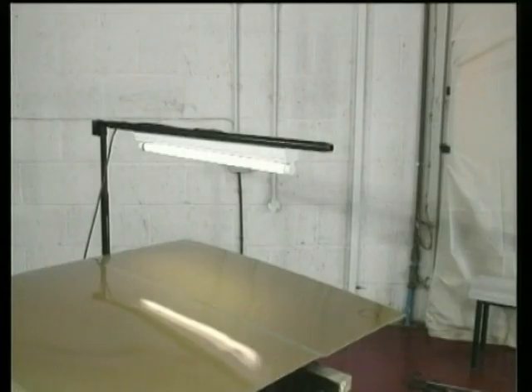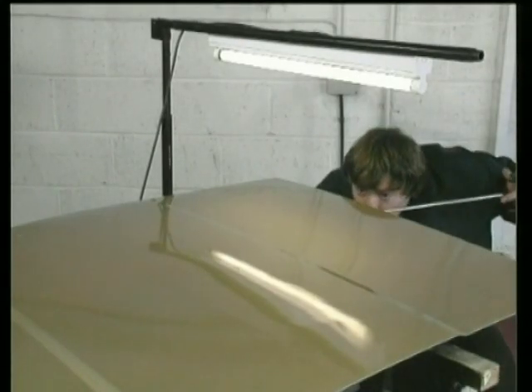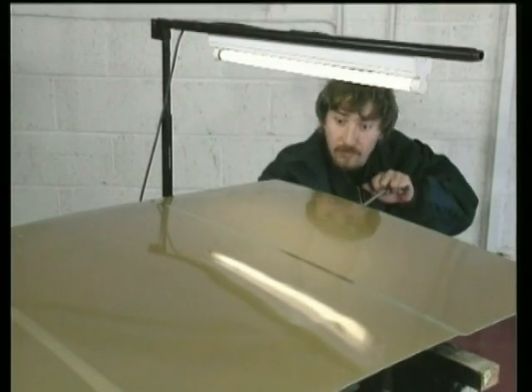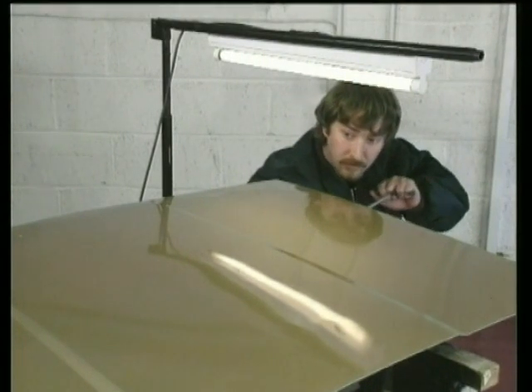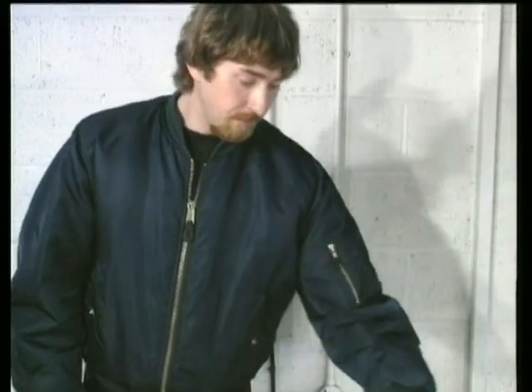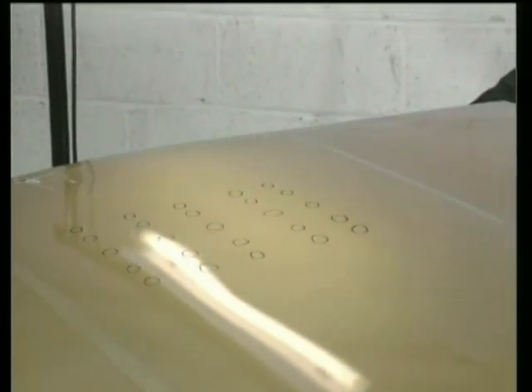If the light is being reflected by a smooth part you will see a straight reflection, except for any deviation caused by the curves or contours of the bonnet. Now using a chinagraph pencil, draw a circle on the bonnet somewhere on a flat spot. Position yourself so that when you can comfortably see and reach the circle, the circle is between you and the light. This is very important — you must always position yourself so that the dent will be between you and the light. Draw some more circles and practice the correct positioning of the light. This exercise should be perfected before moving on.